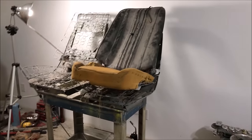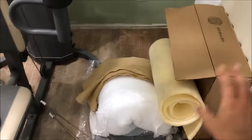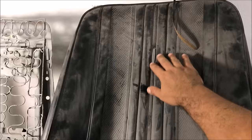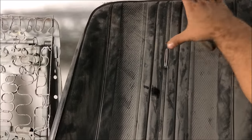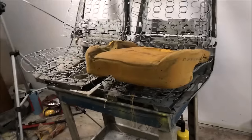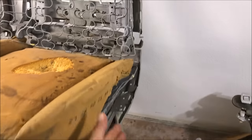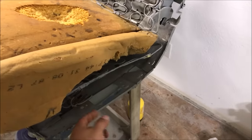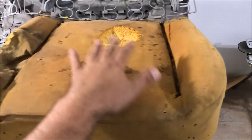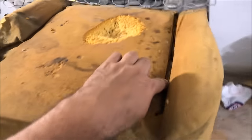The number one thing is to wait until the last minute — when you have all your upholstery and everything ready to go — before you start tearing down these seats. It's real easy to accidentally throw something away and forget your position for your emblem buttons or medallions. You also want to take your covers off and see how they were secured and hog ringed to the seat frames, to get a real good idea. Double check everything.